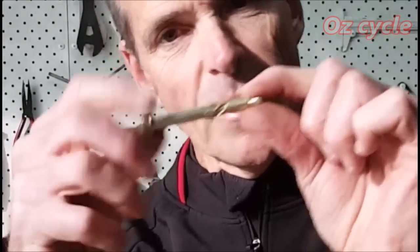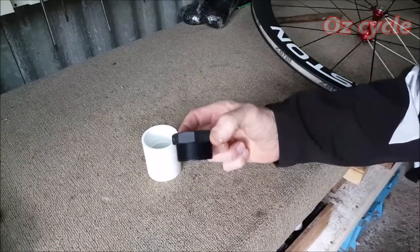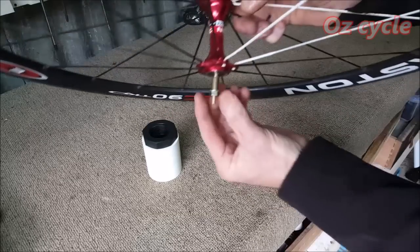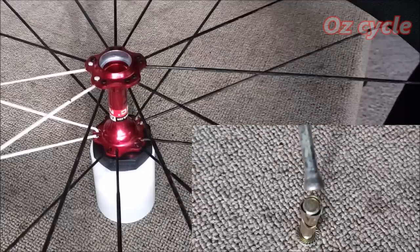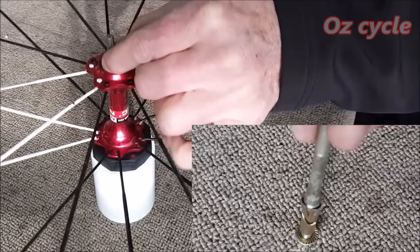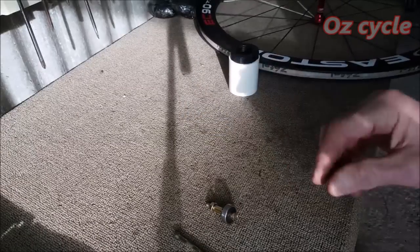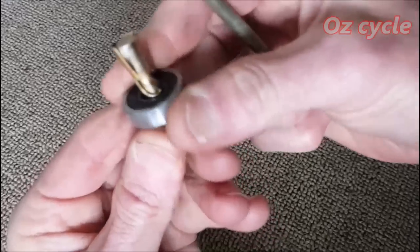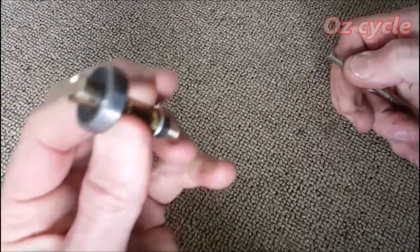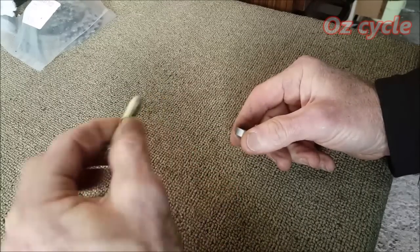Now with the longer dyna bolt, take it apart. Your next tool is a white PVC inline connector, 40 millimeters in diameter. Place the wheel with the dyna bolt on top, then the long inside piece of the dyna bolt through it. Essentially what you do is hit that on there, and of course it's not going to come through — it just pulls the bearing out. Undo it, pull the collar down, pull the bearing off. You can use this over and over.